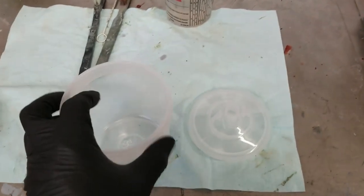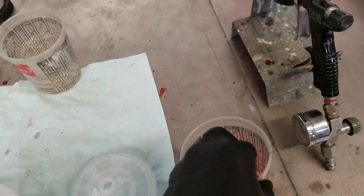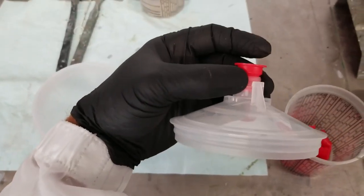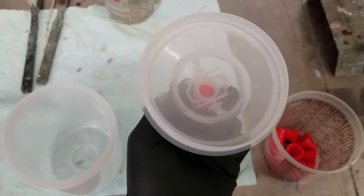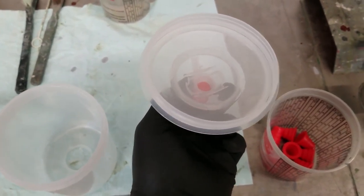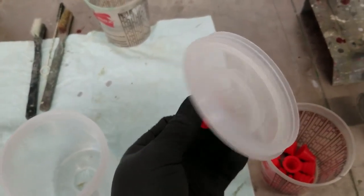That's really cool. If you need to wait a little bit to store them, they come with these neat little caps. You put the cap on there. And there you go, you can store the paint. I like to store them this way to keep the strainer from drying out and getting crap in it, because if you ever shoot one of these after you've left it this way for a couple hours, you may get some stringy crap that's starting to activate already.